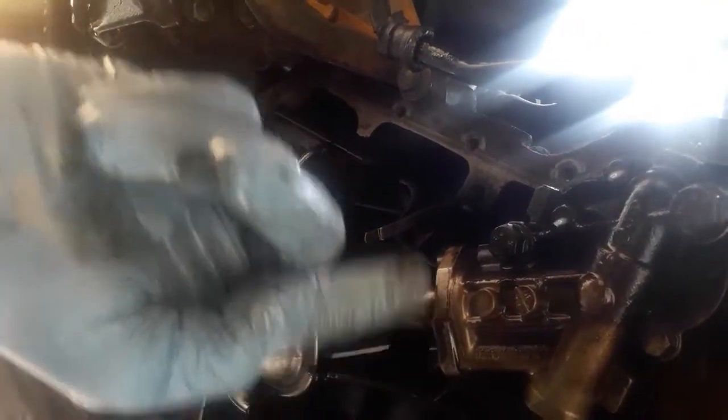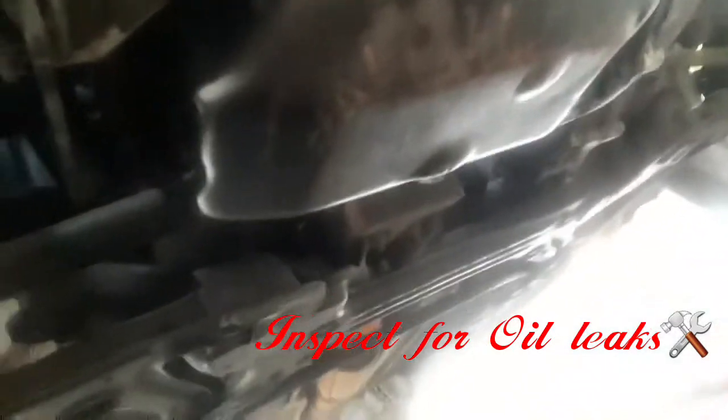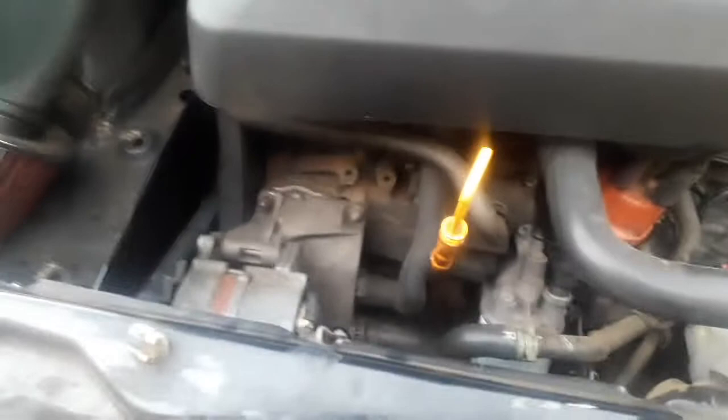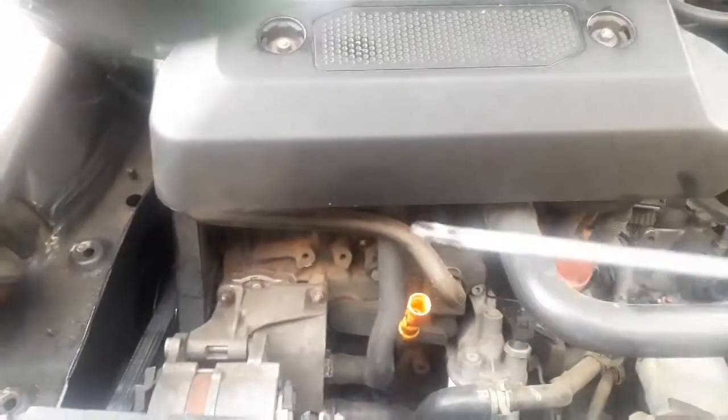In the event that you would need to take out the oil pump, it's just a matter of unbolting those bolts and the whole mechanism should come out. The sump is now bolted back into place. This is just the time to inspect visually for any leaks and anything else you might have forgotten to put back. I've added new oil and I'm going to check the level and top it up.